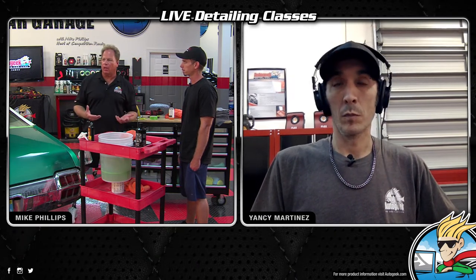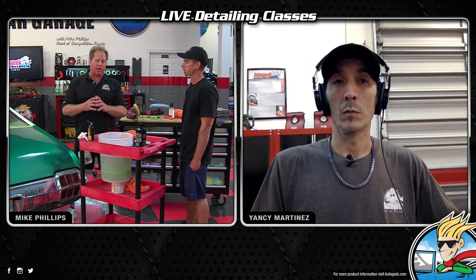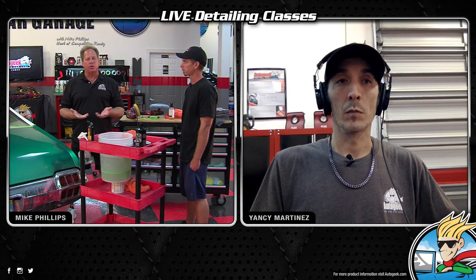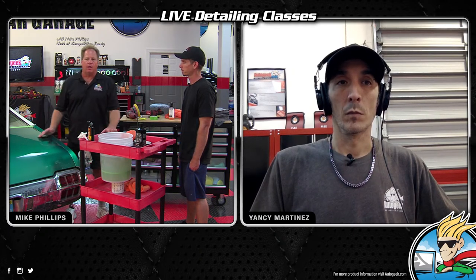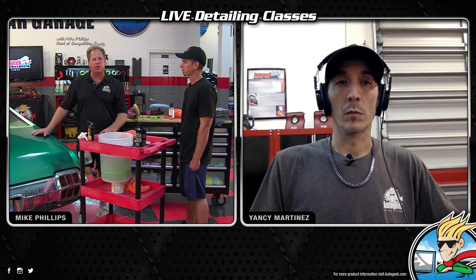A good question. Hey, and there's a million ways to skin that cat. In my detailing classes, I show 3-inch Abralon discs. They come in 500, 1,000, 2,000, 3,000, 4,000, and you can slap those on a Griot's Garage G3 or a Porter Cable with a 3-inch backing plate, and you can machine sand. You could actually hand sand with them. You could use any kind of sandpaper you want. But however you want to do it, just machine sand it down.